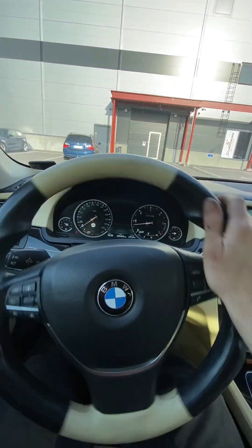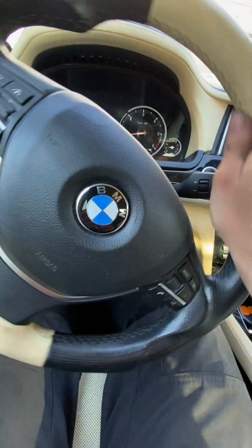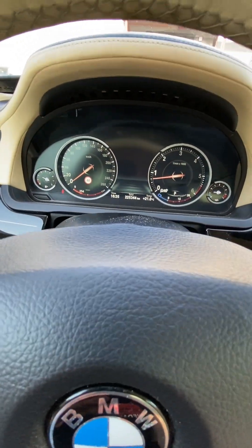I actually recorded a video of me driving it out, but sadly it didn't record for some strange reason. It's October and it's 21 degrees outside — you wouldn't believe that. So I fixed it. It was the front driver's handle — it was just shorted out, intermittently maybe getting a bit of moisture and blowing the fuse. I never knew one could disable an entire system. There were five pages of fault codes. It's all tickety-boo — I programmed the steering end stops back in and all that. No warning lights now.